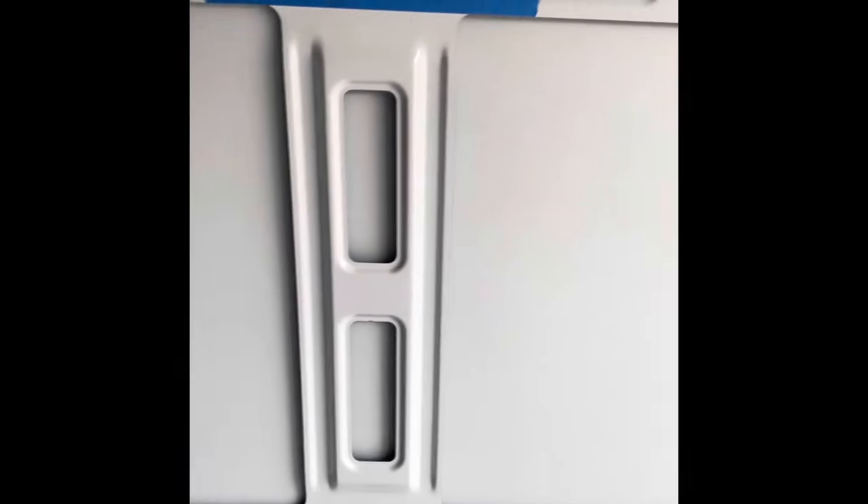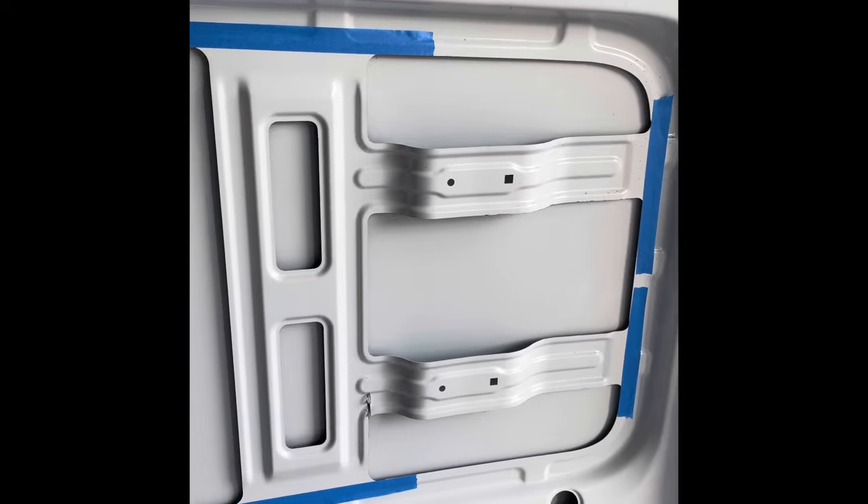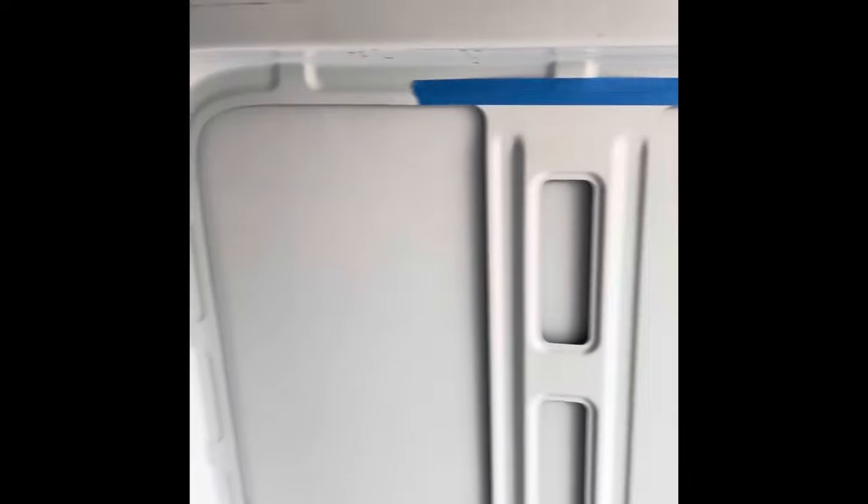Today's job is going to be to do the side flares or side pods on the van, which obviously involves cutting out the large holes. I'm going to use the hand nibbler, which I've got here. I'm going to show the hand nibbler in use this time because I didn't show it in the last video. I've marked up the perimeter first, so you can see I've marked the perimeter at the top on these support braces, which need to be cut out first before I can use the electric nibbler to cut the panel out.